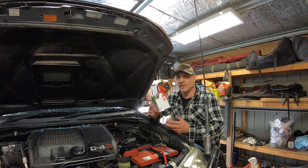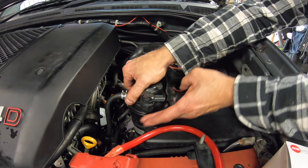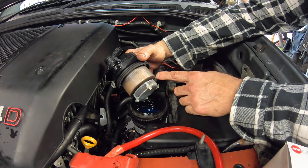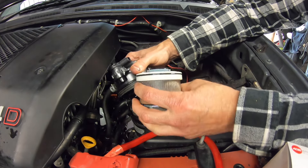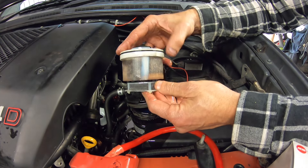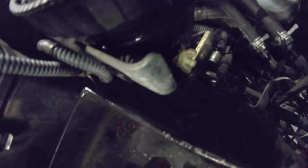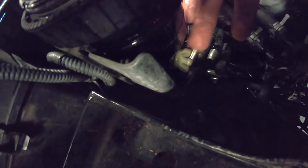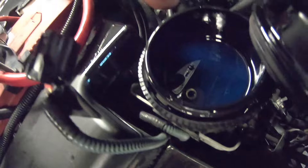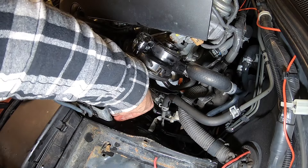Next on my list is the fuel filter. It goes right in here. I normally just disconnect this wire. This here needs to turn to release the top of the cap — give it a bit of a wobble, take it out. And this here's the fuel filter. This fuel filter has done 10,000 kilometers — that's what this whole engine has done between services. You can see it's fairly dirty but not terrible, but obviously needs replacing. Inside the canister you can see lots of diesel. There's also a drain just down here — you unscrew this, and you can either make a mess or hook a hose up to it. I just normally unscrew that and let all the diesel flow out to clean up any gunk inside the canister.